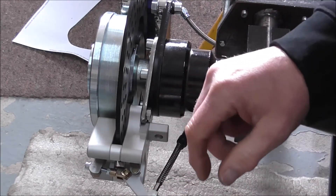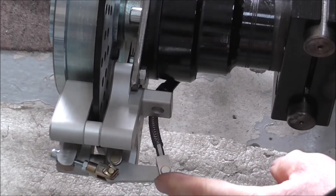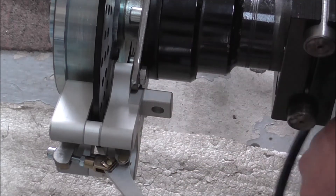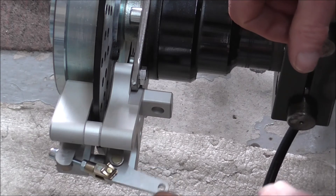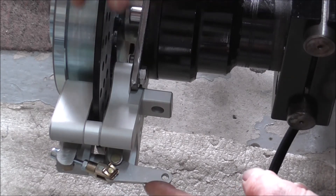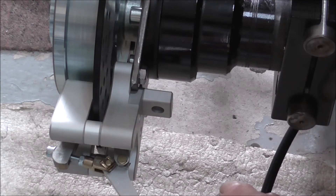You've got this lever here - that's what the mechanism is. That's the lever mechanism for putting the handbrake on when you pull the handbrake lever. As you can see, it gets to about there where it starts gripping the disc, and then once you get it to there that's it - locked solid. Then let the lever off and it releases.